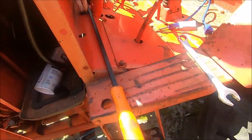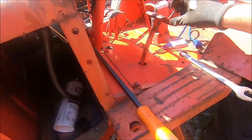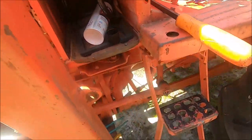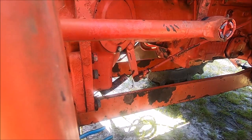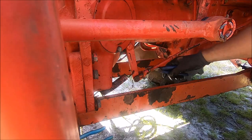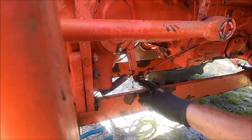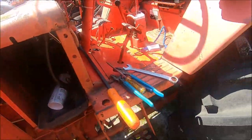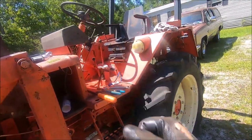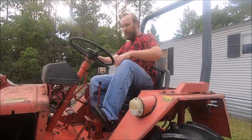Feels much better than it did before and it's not flopping around. Before, if I wanted it all the way up I had to take out the free play with my foot. You do want a little bit of free play, but I think that'll do the trick. Let's put our jam nut back, drive our pin all the way through, and put our cotter pin back in — or whatever it's called, I'm not going to get into those technicalities. So now we have a nicely adjusted clutch. As you can see it's sticking up a lot more, which is what we want, and it returns nicely.